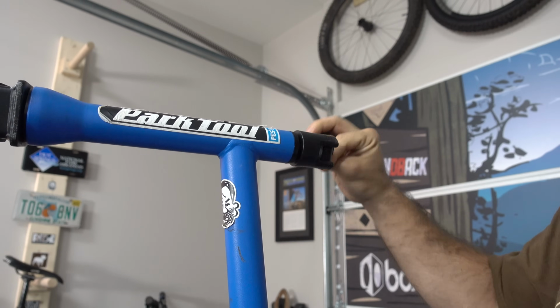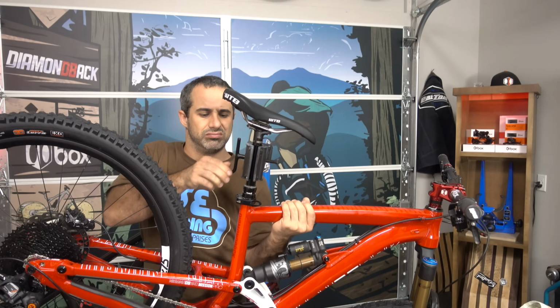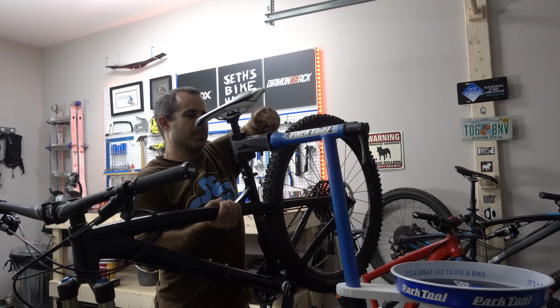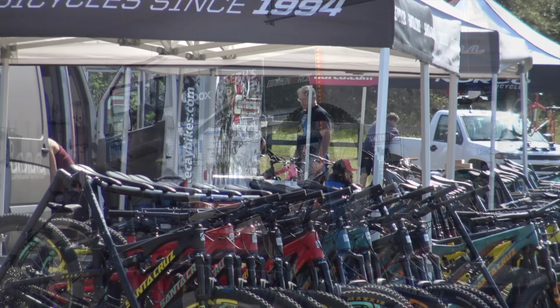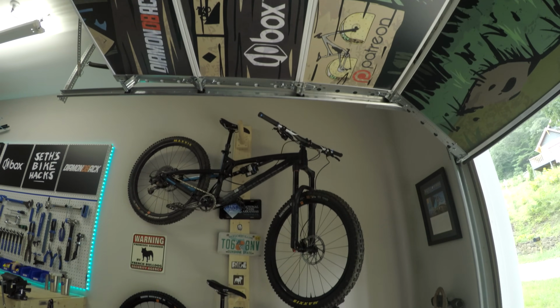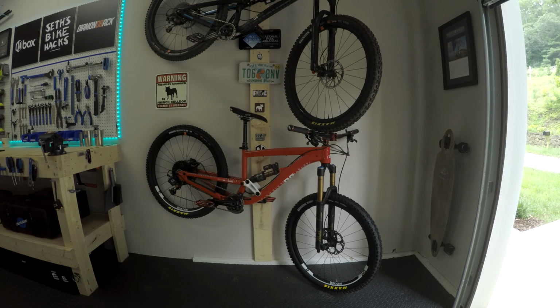Look, when you clamp your bike, just leave the stand loose. The bike will fall into its natural position, putting no appreciable lateral force on the internals. Sure, the bike is pulling on the post, but that's no big deal for one repair session. In fact, demo bikes hang from their dropper posts for entire seasons, and my bikes are always stored that way. This might not be so good though.